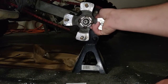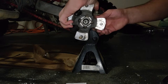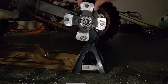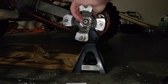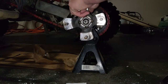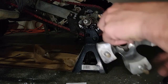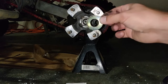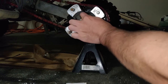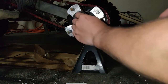I'll go ahead and put both of these on, slide the hub on, and see how loose this hub is on these splines. I think it's because over time it's worn out from not having the correct equipment on here - that's just part of it. Slip these two on, slip this on, and this is the other washer they give you. My issue with that is the castle nut will go on but your holes aren't going to line up correctly.